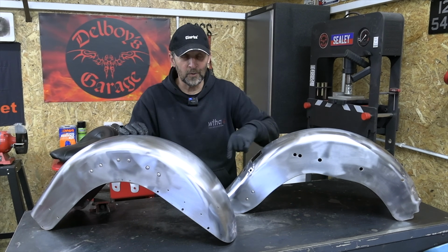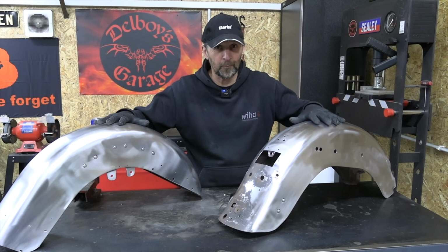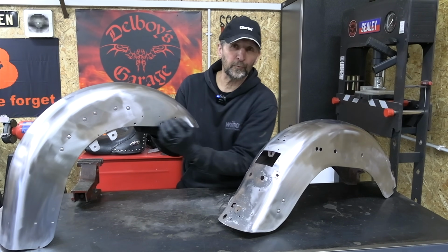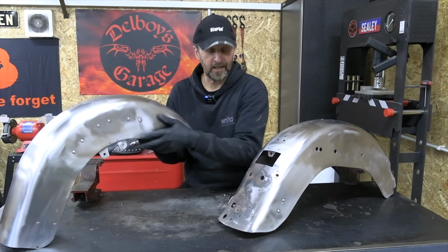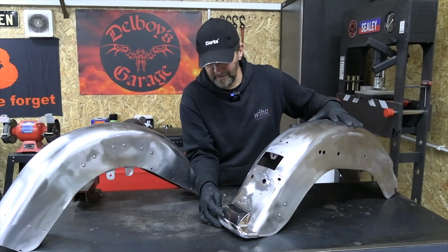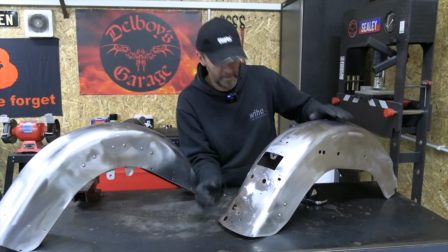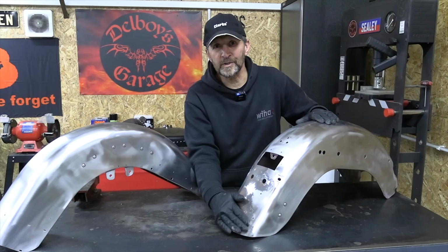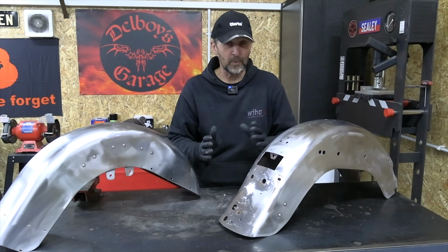Well, next, that is after the welding repairs. And those repairs basically are welding up holes that I don't need. I'm going to eliminate all the chrome off these mudguards. They're going to be completely sleek and in single colour. So for instance, all this chrome trim that goes around the front of the front fender, all these holes, there's about a dozen of them, going to weld all those up and then fill them over so they're not there at all. Same goes for here on the back of the rear fender. You've got this big old piece of plastic door knocker furniture that fits on the back there. That's being eliminated. I'm getting rid of that. And all that there, these little holes that are normally for wiring and whatnot, for a light, if you want to put a light in there, they're just going to be welded up, little plate on the inside, and then shave over the top, nice and smooth, sand it round, and then just paint over so there's nothing there at all. So they're not repairs to damage as such, they're just holes welded up that I don't need in the future.